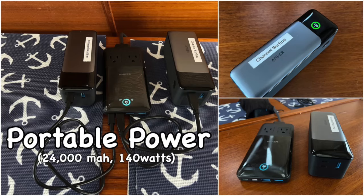We bought two of these because one battery will completely charge a MacBook Pro battery. It also has a fast charging rate — 140 watts. It does require the cable that comes with it; it'll actually say 'max 140' right on the end. Not all USB-C cables are created equal, so not all of them will charge at 140 watts.